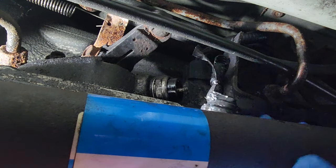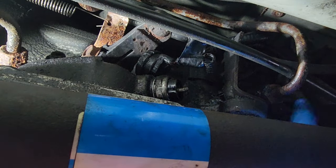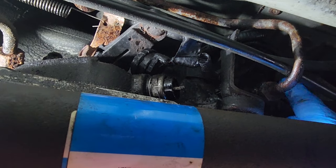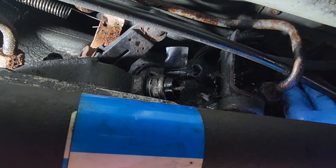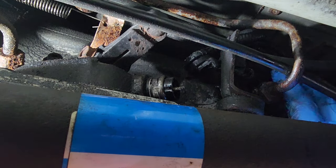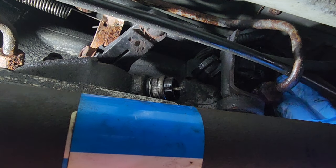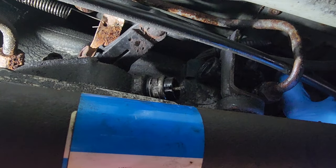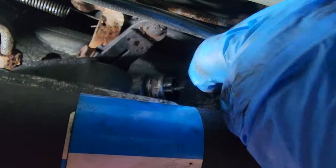You know, this drive shaft makes this really annoying. Now, I hate the way this is routed. It's routed dumbly. I can't get enough slack to work on this. So I'm gonna pull this back through this bracket so I can bring it down, so I can cut the wires and then splice in the new pigtail. Dumbly. Good word, bro.